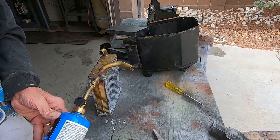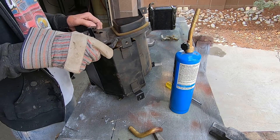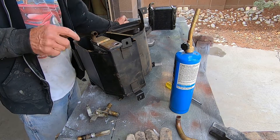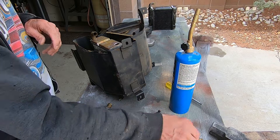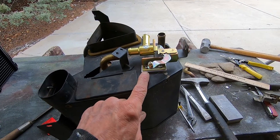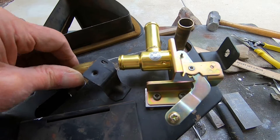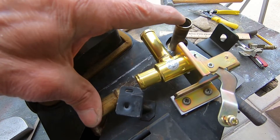I might not have to rotate this at all. I'll either cut this off and get it soldered back in there. I ended up needing a 3/16ths of an inch spacer right underneath the valve. I got my new valve just to make sure it's the same as the other one - I don't want to find out there's some difference after I get everything modified. And the heater core can just set in there just like that. I can put a little small piece of hose here to connect those two. So I think I can go ahead and solder this one in now.